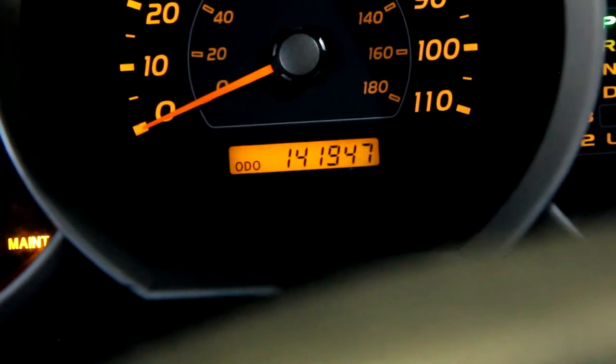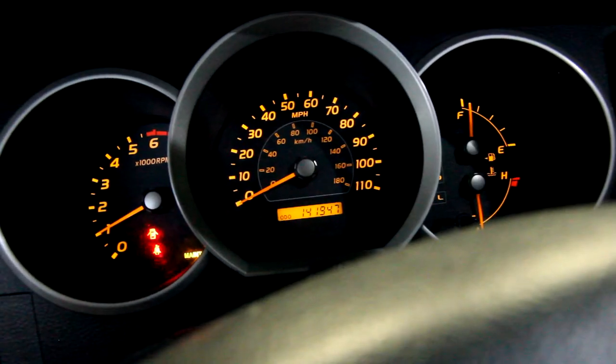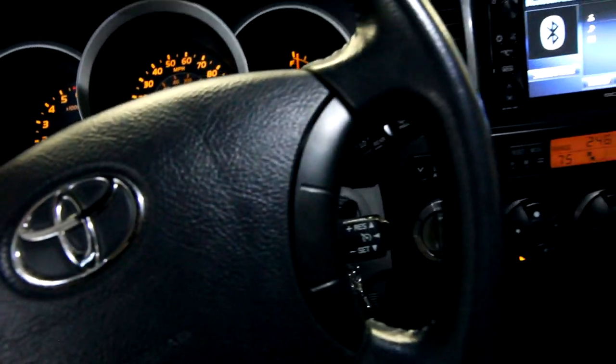Now that the new oil filter is on and the oil cap is twisted back on, I'm turning on the engine to let the new oil circulate for a couple of minutes. Then I kill the engine and check with my dipstick to see if I got the right level of oil in there. Here I am going for the dipstick — I clean off the leftover old oil with a shop towel, do another dip, and if it is where it's supposed to be it's between those two dots on the dipstick, which it was for me.